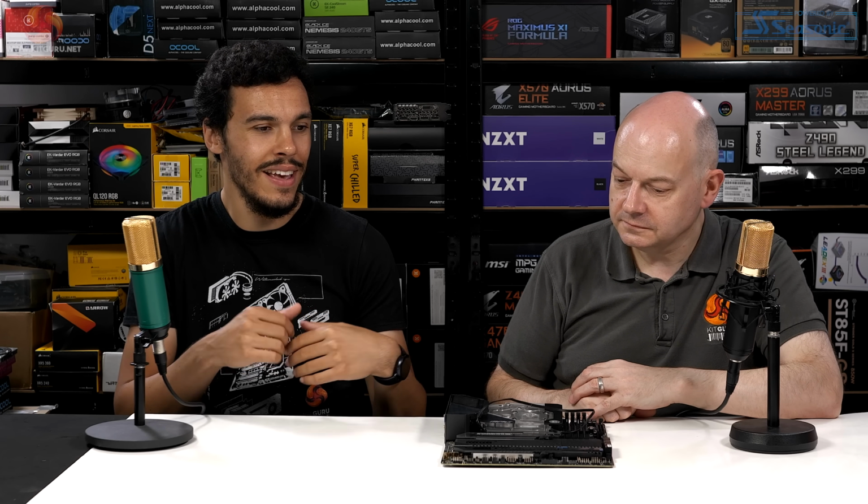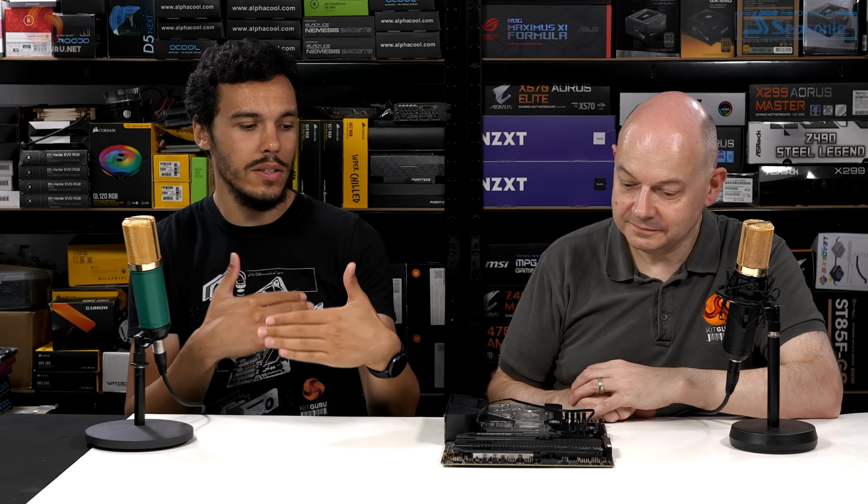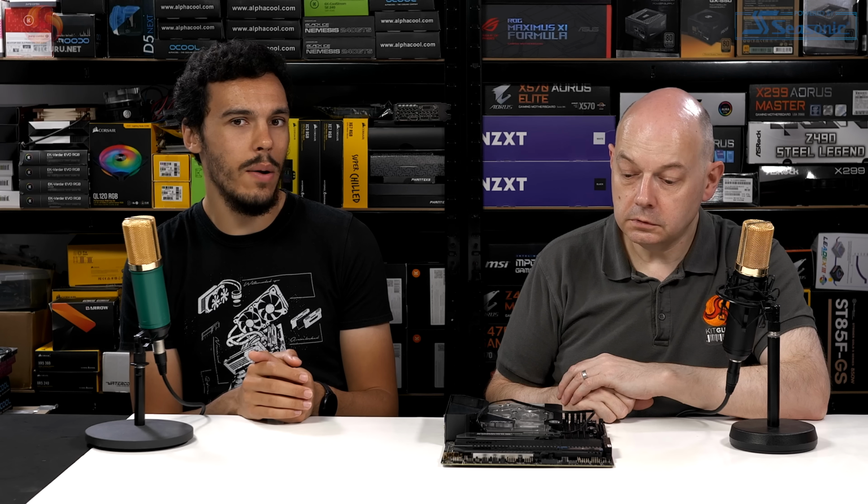It was back when dual GPUs were a thing and you had onboard Crossfire. But critically, they were overclocked compared to their single GPU counterparts. Before that, with the 4870X2, the 6990 and all these other ones, they were always underclocked, always a big compromise. This was overclocked, so it was better than a pair of individual cards in Crossfire, and it was cooled via I think an Asetek pump block unit and a single 120mm rad. It was like 500-600 watts for the GPU, to the point where you had to have specific, good power cables to feed the dual 8 pins, if I remember correctly. And that was a single 120 rad with a good fan. That is always my benchmark.